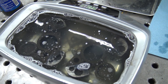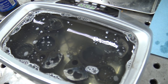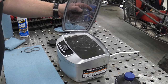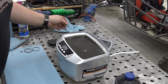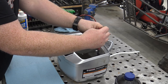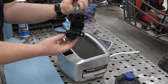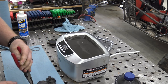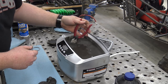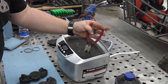The ones on Amazon you can run for like an hour. We're going to run this two times and flip everything the opposite way and run it two more times at 480 seconds. The ultrasonic cleaner ran for around 20 minutes, and halfway through I flipped everything. I'm going to use needle nose pliers to grab my parts out — that'll get hot. Make sure to get all the water out of it. This thing comes insanely clean. If you don't own one and you work on small engines, cars, or anything, this is one of the handiest tools you can get.